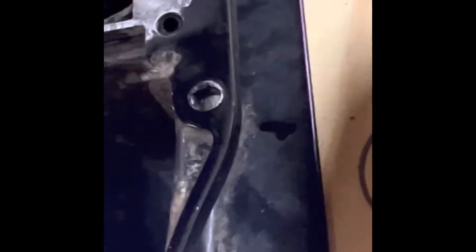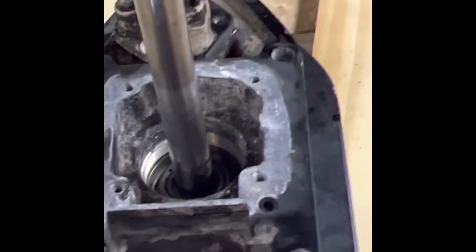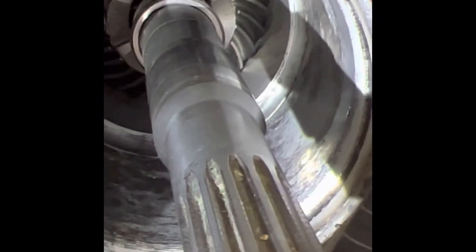Before I put this in, there are two shims right here. These two shims go right inside of this housing here. As long as you haven't changed the bearings, your shims can be reused. If you change the bearing, you may have to reshim it. That's the shim set in place right there, right over top of that. My next video will be with the nut on it and the gear set up in its place. I'll have it locked tight and then I'll show you how to do the torque and what special tool you use to lock it in. All right, see you in the next video.